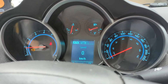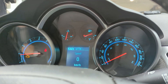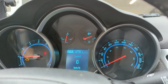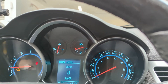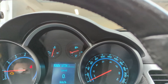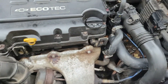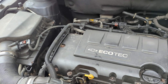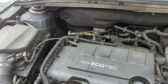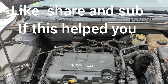I'm back from my drive — barely ten minutes. There's my temperature needle, right where it should be. It is winter, so on a hot summer day it might read a little warmer, but I think this is good. Let's double-check under the hood and make sure there are no leaks. I think we're back to normal. The car was running cold and it was caused by a jammed-open thermostat. I'm pretty sure it was because of this stop-leak product I put in 10 months ago. Thanks for watching — hope this helps.